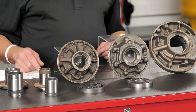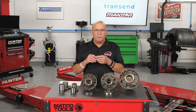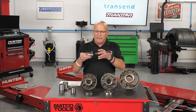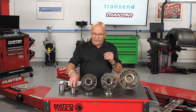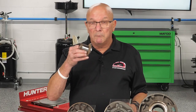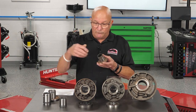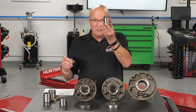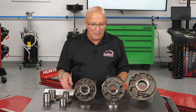If you're using a bushing, it's not a real hardened material — all converter hubs are hardened to a point — but if you put a bearing in, this hub becomes a bearing race. I don't care what anybody else says: if you're using a bearing, this becomes a bearing race.